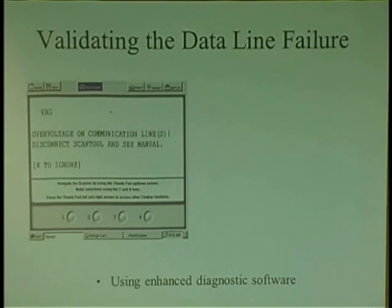When you plug this thing in, you plug it underneath the dash, and you can actually work out here. You want to see whether or not these two ground LEDs light up, pins 4 and 5, okay? And here's your pin 16 for power. You hook up your scan tool and it's dead. You're like, well, what's going on? You probably lost power or ground. You most likely lost power. So now you have to take time out to find out where the power came from.